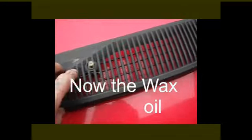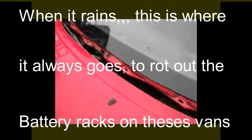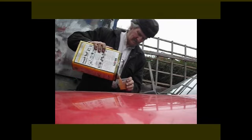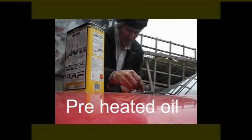There's the trim that goes across the front of the windscreen — I call it a spat. All that is in good nick, all under the windscreen was in good nick. But I wax oiled everything. I've done four vehicles with wax oil now. I preheated the wax oil so I can tip it in a little jug and before it goes off, paint it on. Every year I touch it up and it just stops it from ever getting rusty — all along there, just underneath the barrier. Then the trim can go back on, and that ain't never going to see any water.